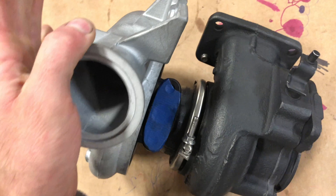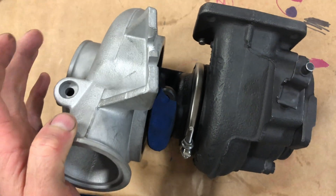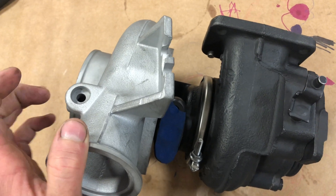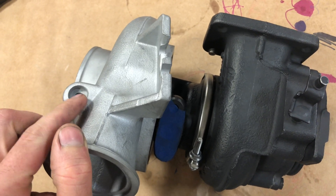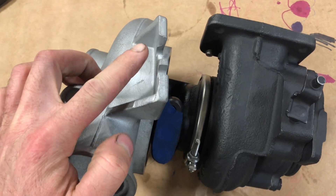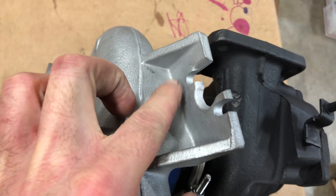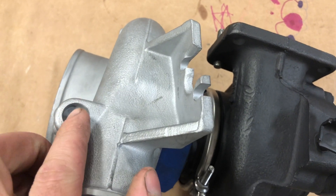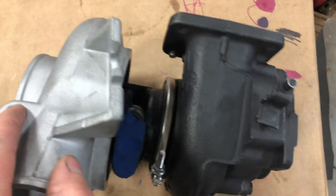The difference in the HY model versus the HX35 is the HY came on the automatic trucks. The HY looks different because of this area here where a wastegate actuator bolts directly to this part, and there's a nipple off of the wastegate that goes directly in here and mounts with an O-ring.